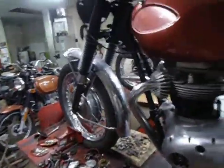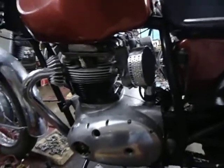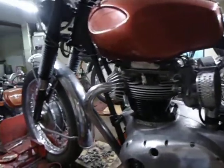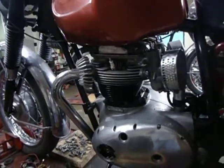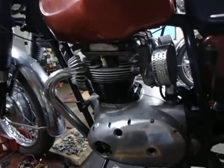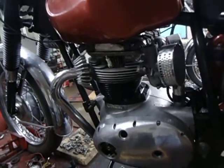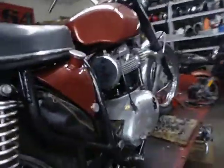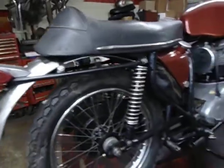This one on the lift that I'm working on is a 1970 Lightning — very low mileage bike. I had the top end off, re-ringed it, and redid the valves. The bike has seven thousand original miles on it. I didn't get into the bottom end or the sludge trap, as the bottom end is immaculate and I don't really see the need to service it, so we're going to finish this one up.